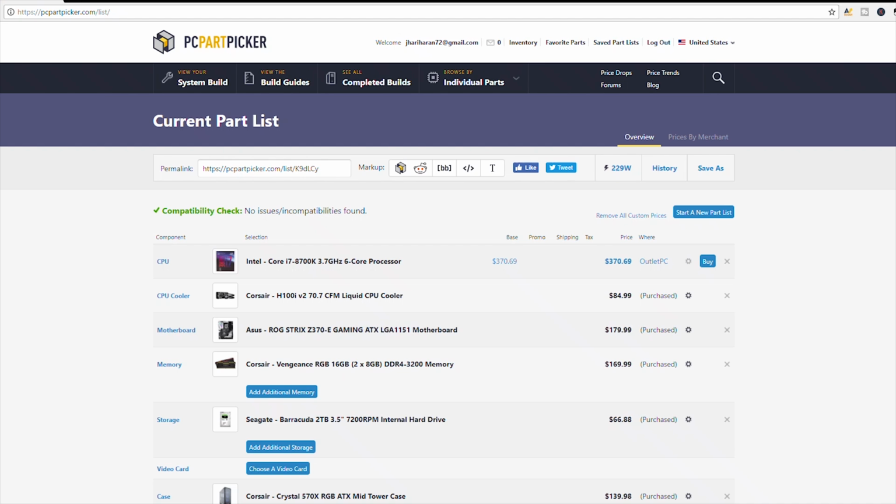Finally, make sure that all your PC parts are compatible. When I say this, I don't mean go to PC Part Picker and see if it says compatible. I mean manually check if each part is compatible with each other. For example, many reviews of my case highlighted that Vengeance LED RAM would not fit if I installed a radiator on the top. Luckily for me, I had front radiator support as well, but if this case didn't have that, then I would have to get another case, RAM, or AIO. But PC Part Picker would have never told me this.